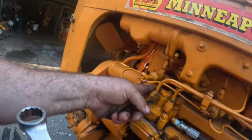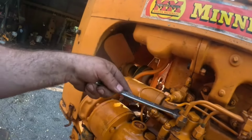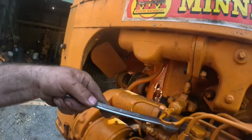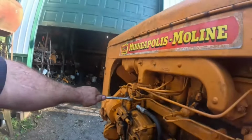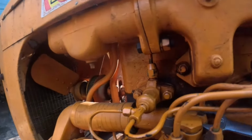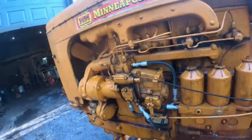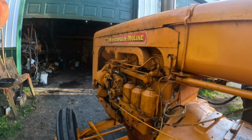But that's okay. Man, that was so hard to get to. I don't know if I should crack a return line too. That's all. I'm gonna loosen that one up. Man, that one turned really easy after I got it started. Oh, well, that's that one. I need that. Okay, return line's loose, and my top of the injection pump is loose. I'll set you right here. I don't know, maybe you'll see before I do if there's any fuel coming out.